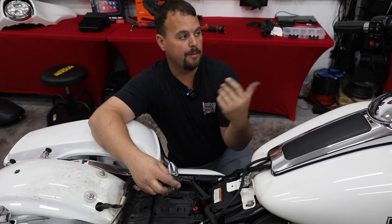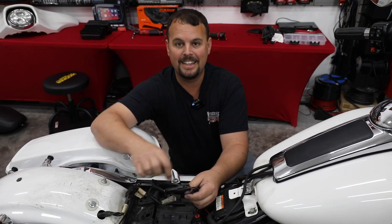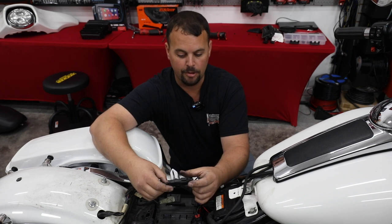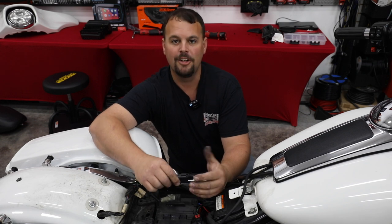So once you change your thumb controls, which we're gonna be doing in our next video, you're gonna have to actually repin this connector. If you don't repin it correctly, when you change your thumb controls, your horn's gonna be stuck on all the time. It's gonna be very annoying and you're not gonna know what to do.